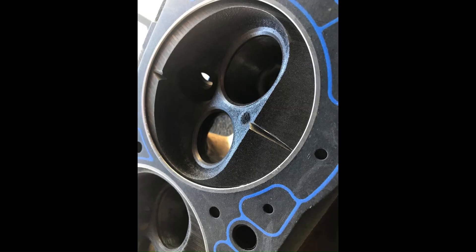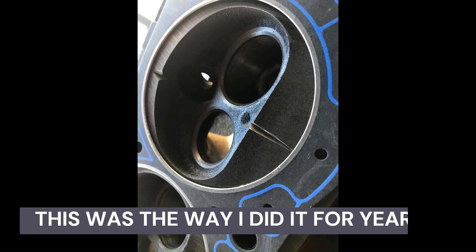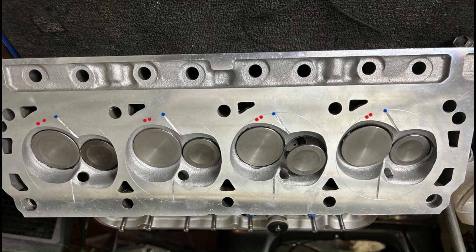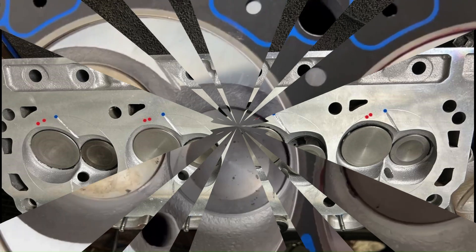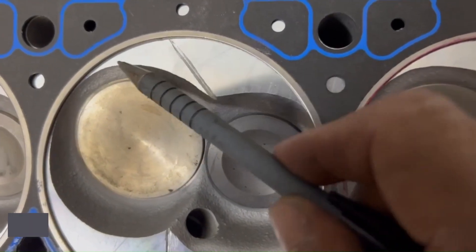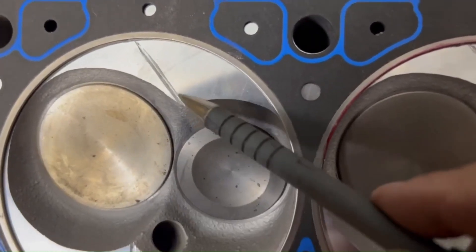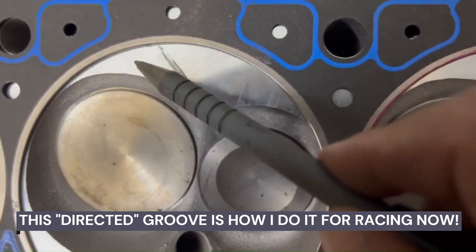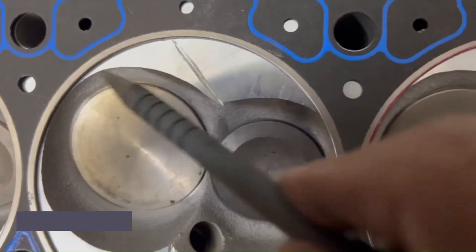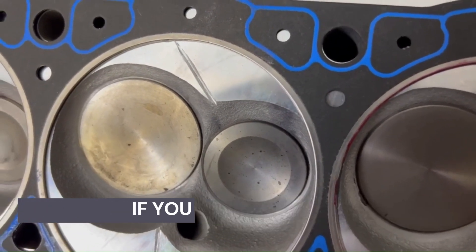The north and south v-groove application works really well from mild to racing applications. The two red dots signify temperature and pressure spike areas. This is the directed v-groove process. Right there is the lean side of the combustion chamber — that's the short side — and combustion pressure builds up right here, shoots right there, and consumes all the basically unburned fuel right after TDC.